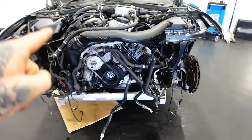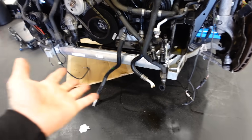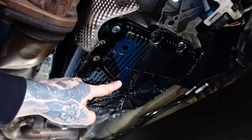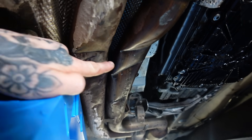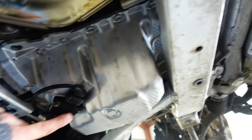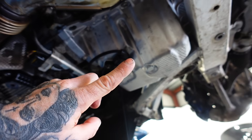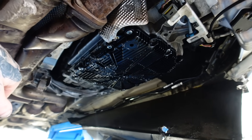Now we've actually figured out where they go — it's an oil cooler on the bottom of the subframe. All this on the floor is gearbox oil, and that is because there is a huge hole in the gearbox sump. That was caused by, we think, a forklift at the auction place. They've obviously lifted the car up, squashed the exhaust, and damaged the gearbox sump, as well as the engine sump, which we replaced in the last video. Massive shout-out to Copart for squashing the sumps.